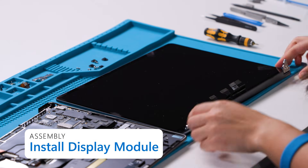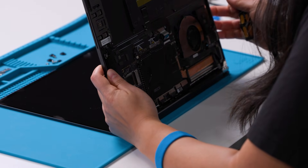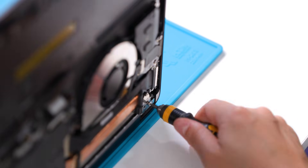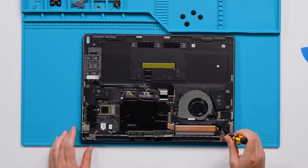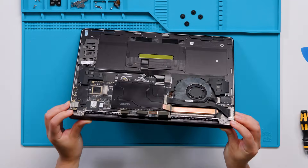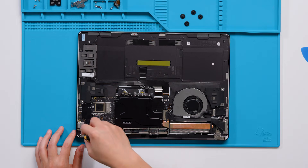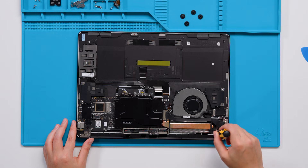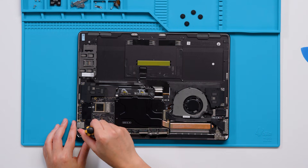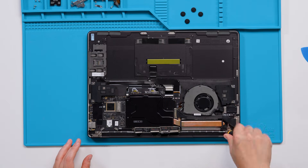Install the display module. Place the backside of the new display assembly down with each of the hinges set at 90 degree angles. Carefully align the hinges into the pockets on the keyboard assembly. Pre-fasten seven new hinge screws using a 6IP screwdriver. Next we need to check alignment. Close the device and then loosen the seven screws about 90 degrees or a quarter turn. Adjust the alignment until the gap between the display assembly and the keyboard assembly is as even as possible. Tighten down one screw on the left hinge until snug. Adjust to the right side so that the chassis surface is flush with the display assembly. Tighten down one screw on the right hinge. Repeat as necessary until the left and right gaps are even and the back surfaces are flush. Tighten all seven hinge screws.